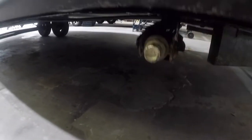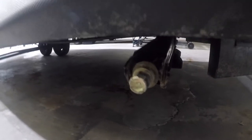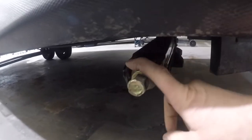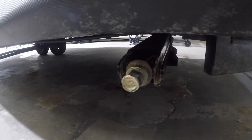Next, we'll come to the stabilization jacks. It's important to remember that you level the trailer as best as you can before you use the stabilization jacks, as they're not meant to level the trailer. They're located at all four corners.